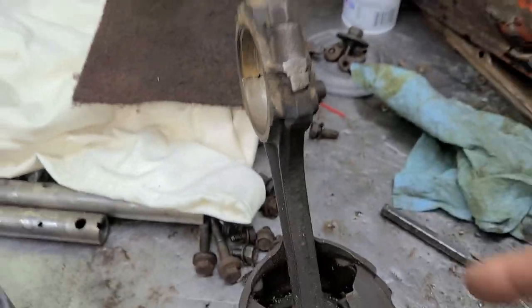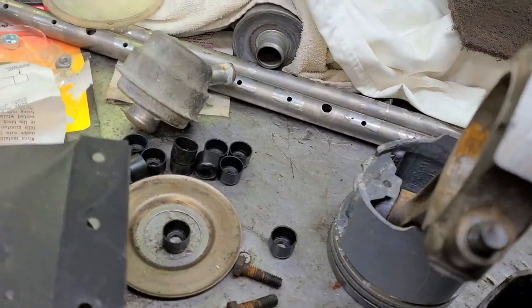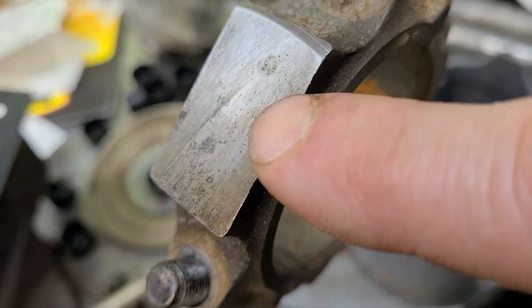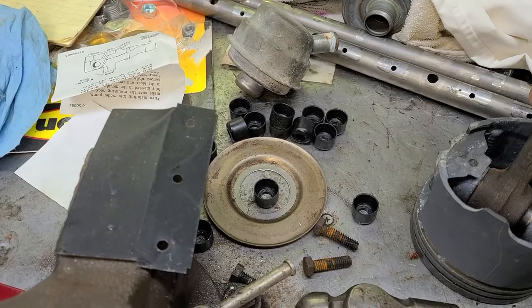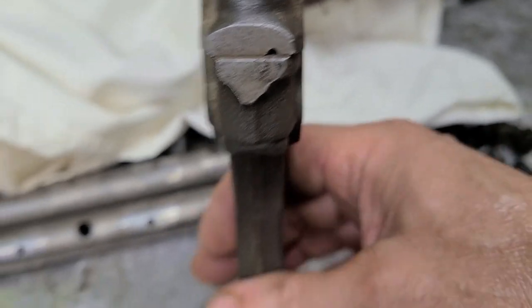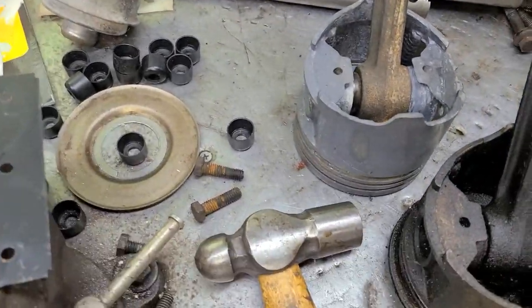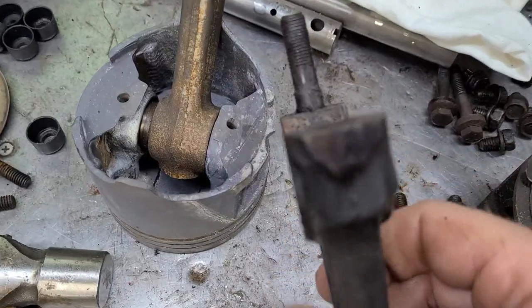If the camera will focus — now let's say you clean everything. I can see a little faint mark on this one; there's a little faint mark, almost looks like a four or an A, but it's very faint. Now let's say you clean the connecting rod and you come up with something like a Maltese cross, which means that connecting rod assembly has been remanufactured by Chrysler. Let's say you come up with something like that.